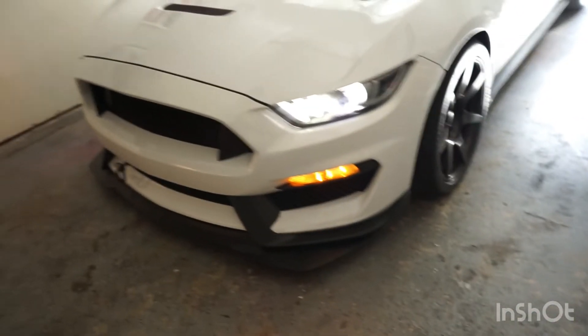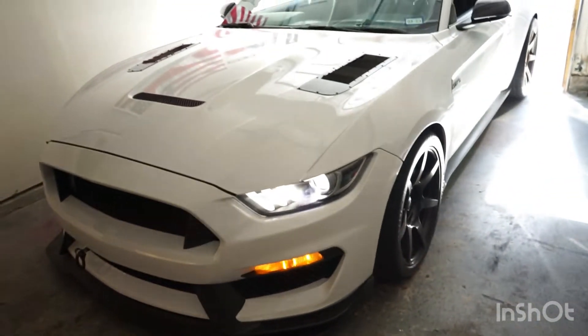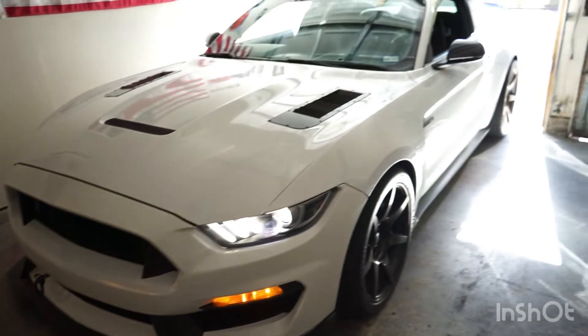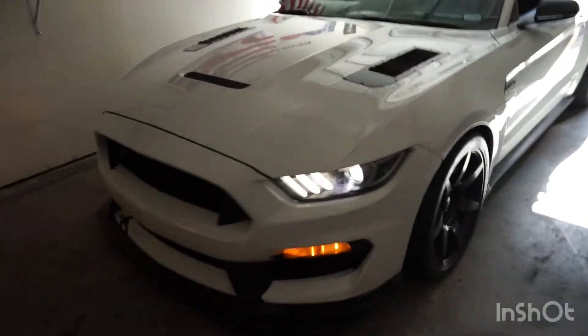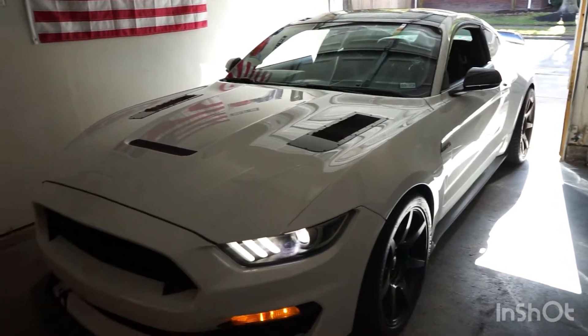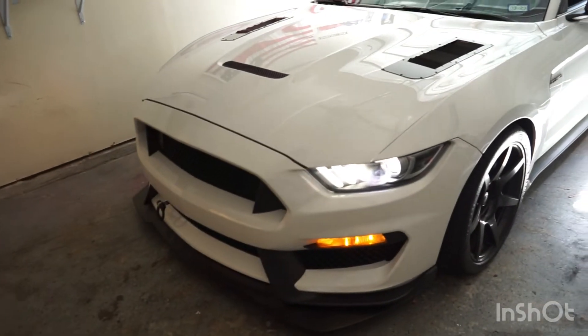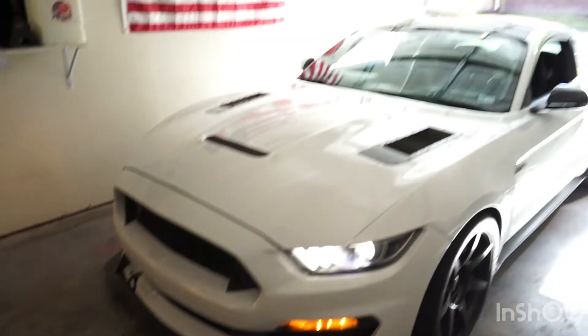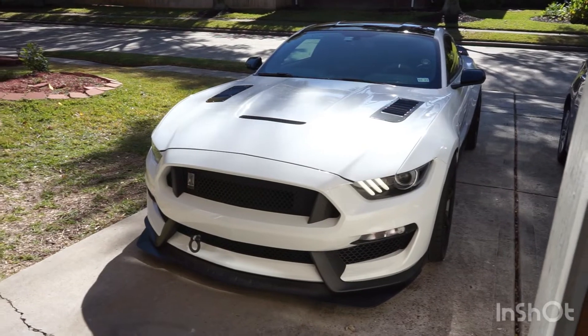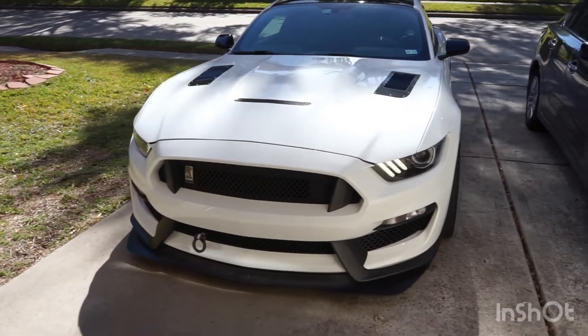And that's how you change the fuel filter on a Shelby GT350 or GT500 — they're all the same. I don't know if the Coyote-equipped cars have this filter but every 30,000 miles is the recommendation. If you want to do it sooner it wouldn't hurt. I run E85 on this car so I'm always pumping gas — the more gas it sees, the dirtier the filter gets faster.